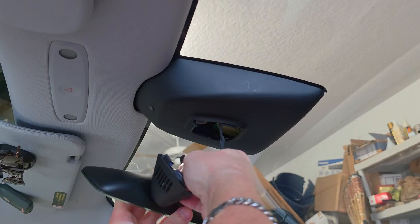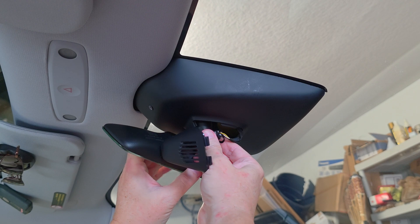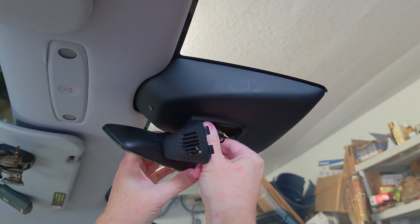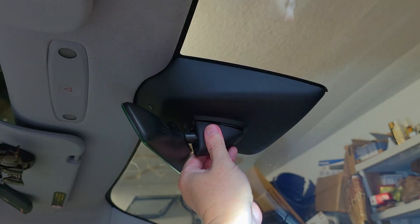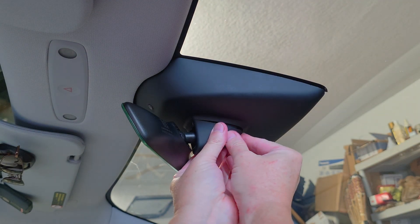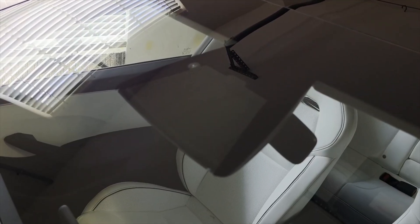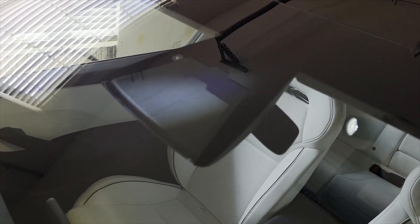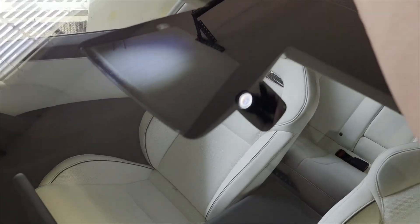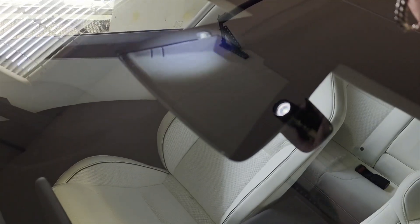Then you can put the mirror back in. Remember, we turned it about 30 degrees counterclockwise, so that's how we're going to start — then turn it back to tighten it. Hold the post and the mirror and twist both at the same time to click it into place. Finally, the triangular piece clicks into place; I found it easier to put the point in toward the mirror first and then pop the other side in. And now you can see it's clean — the cameras are going to have a nice clear view through here. Thanks for watching.